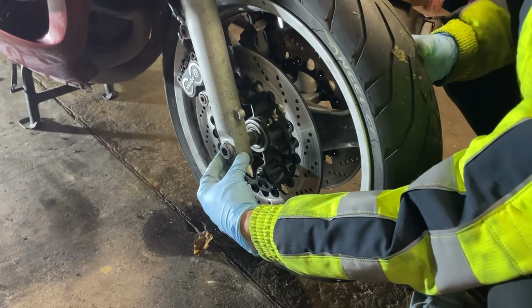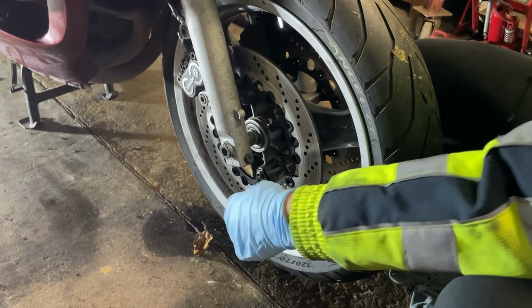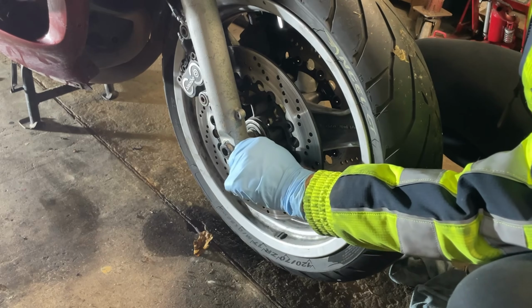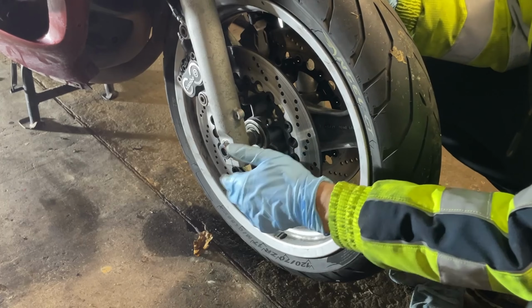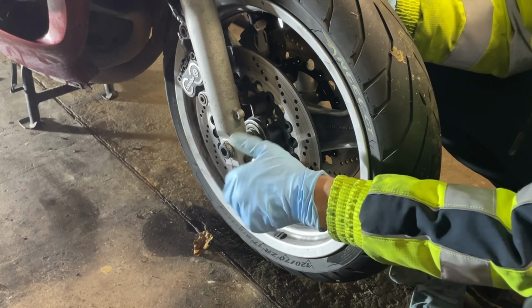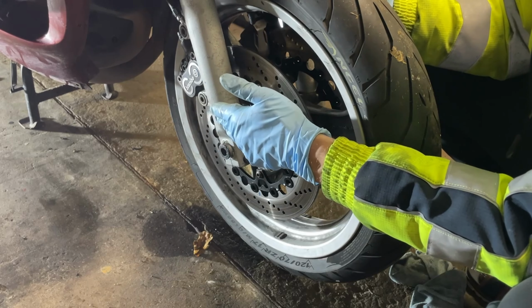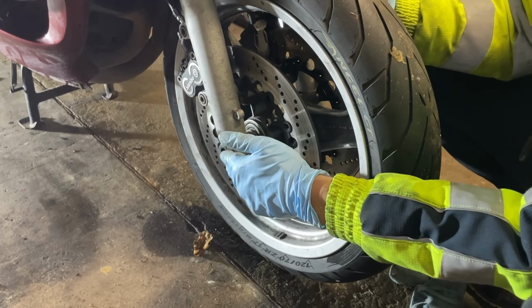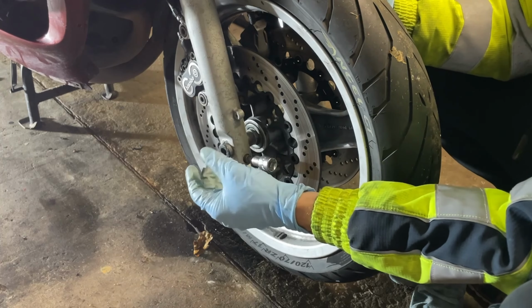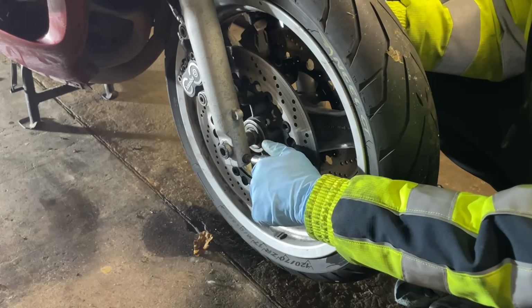So here now I have to use the spring, the suspension. So this one will align, since it's loose, it will be able to move on the axle, and then I will torque it when it's been aligned. If you torque it now, could be you have a little bit of a difference, and yeah, you will feel that, you will get vibrations, misalignment of your front forks.